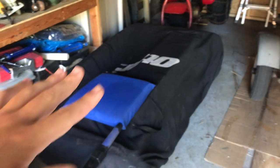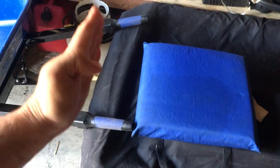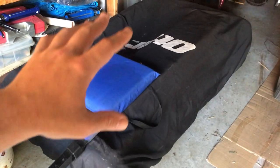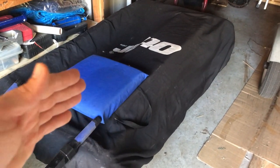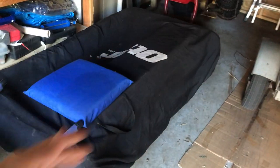You want the back of the sled sitting toward the back of the skis — the back of the skis stick out about four to six inches, and the front of the skis stick out about a foot to a foot and a half. Skis tend to be measured in centimeters, so like mine are around 155 — just measure them and compare to your sled length. You don't necessarily need skis that are three feet longer.